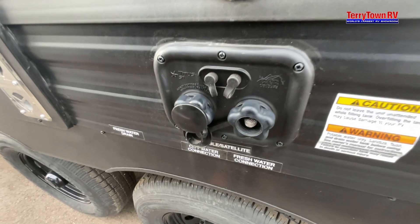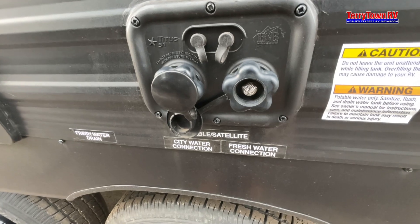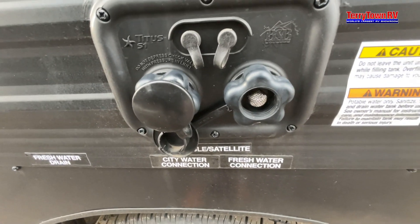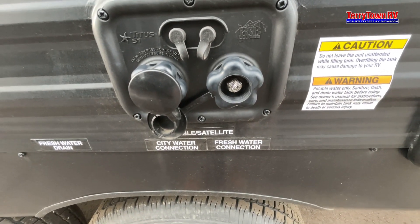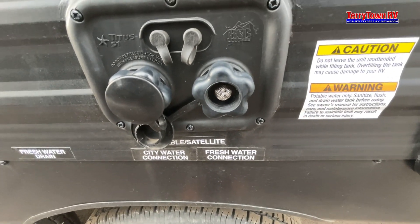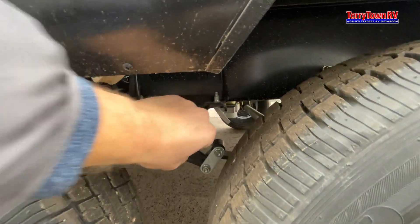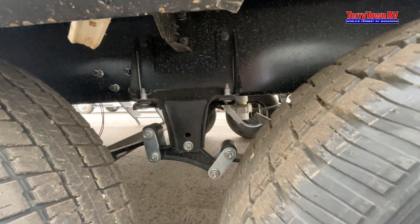Moving down to the fresh water connection — this is for when you're camping in the middle of nowhere. Go ahead and plug a pressurized hose into here, then watch the reader on the inside as it grows; it'll eventually fill up. Go ahead and shut it off and close it up. When you're out in the middle of nowhere and need water, go ahead and flip on the water pump — it will then draw water from the tank you just filled. The drain is usually right there behind the tire; the little white piece — just grab it and pull it. If there's any excess water after your vacation, go ahead and empty it out with that.